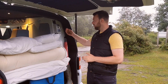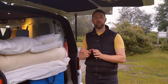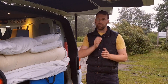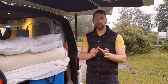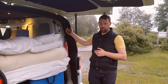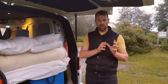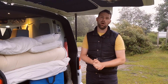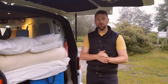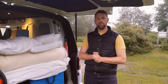It will really help you get the most out of your battery, and it lasts as long as it possibly can. Now, like I said just a minute ago, this is an MPPT, which stands for maximum power point tracking. The other system is a PWM. They're two slightly different systems. They both do the same job in different ways. Depending on the size of the solar panel system you have, one will be more appropriate than the other. So anything around 120 watts or maybe even 150 watts or below, you probably want to be looking at a PWM system, which are cheaper, generally a bit more reliable.